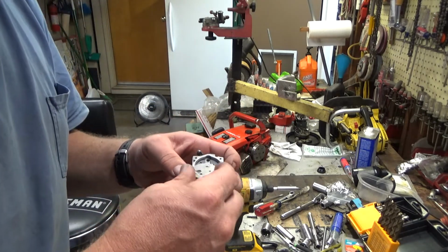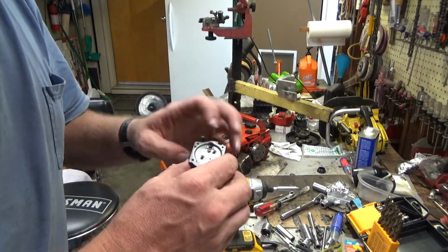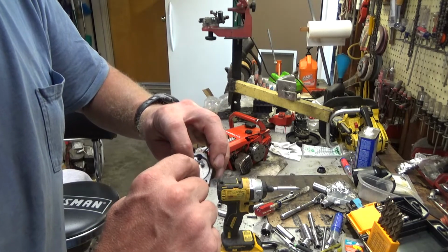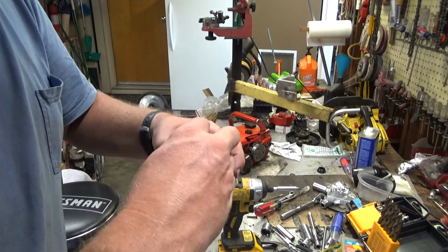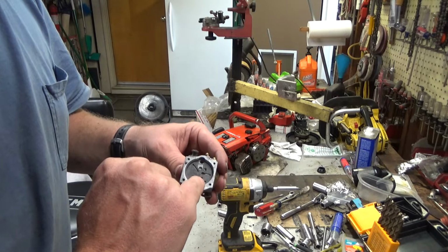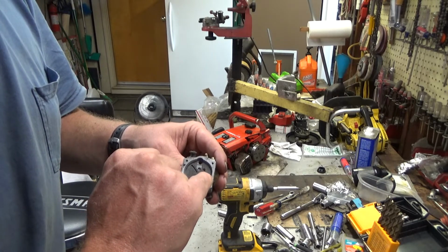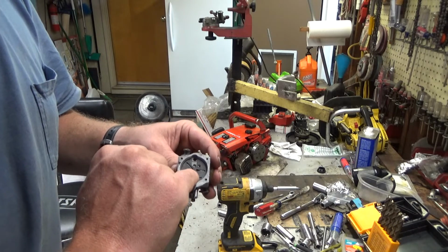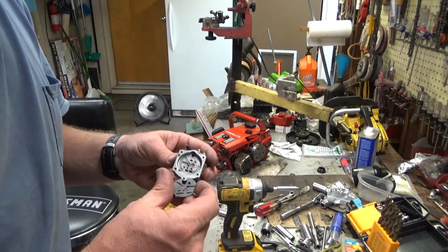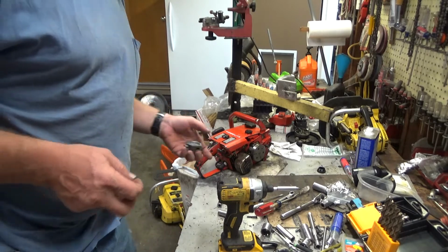I'm not going to get too deep into this, but you've got your two screw holes that hold it down. As fuel flows in, it comes through that hole and down into the metering area. And you can see there's a little hole in the carburetor right there, a passage that allows free flowing fuel through here. That other gasket seals that off, and it doesn't allow fuel to flow. Nice little bit of dyslexia there. So anyway, that was one of the problems on this saw.